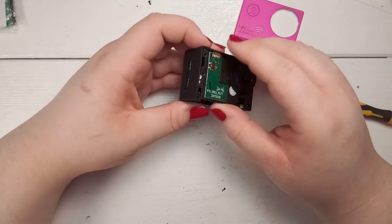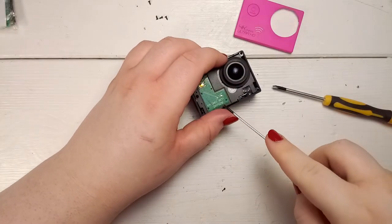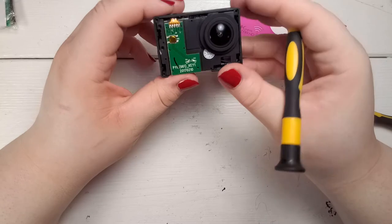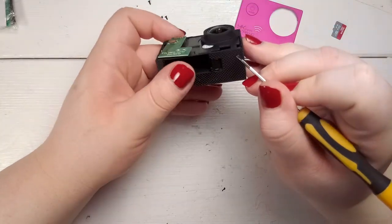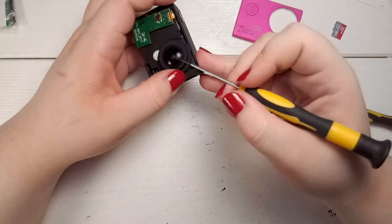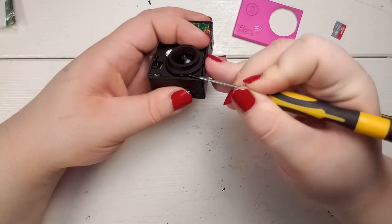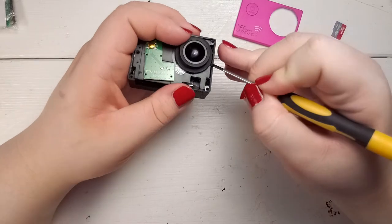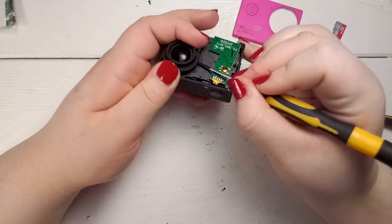At this point I tried to remove the plastic cover but without any luck. Use a small screwdriver to remove the small PCB — it's only held in place with some plastic studs. Gently remove it and be careful not to rip the flat cable as it's very fragile. Use a small screwdriver and try to remove the plastic parts surrounding the lens; it is held in place by four hooks. Work your way carefully around it until you get the screwdriver between both parts.